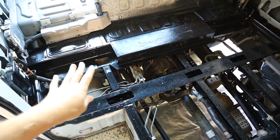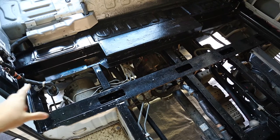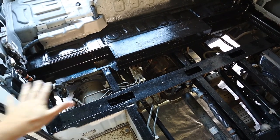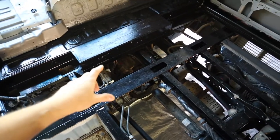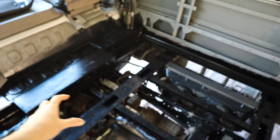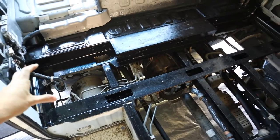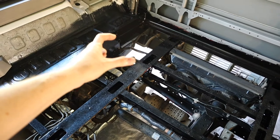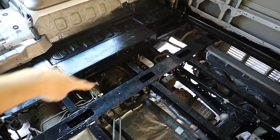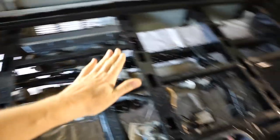I've decided I'm going to reinstall the passenger seat. Because I want to use the exact same mountings and bolts that were originally in the seat, I'm actually going to do this piece in 12mm — the same thickness as the original floor — so that the bolts will tap back nicely into that space. On the other side of this step I'm planning to build a dog den crate area, and I'm probably going to build up this little bit of the floor to the same height as the step with storage underneath. So this section will be hidden under storage when the build is done — you won't notice the first bit of floor is 6mm lower.